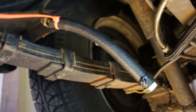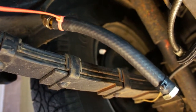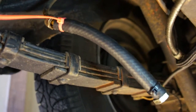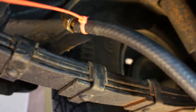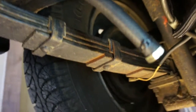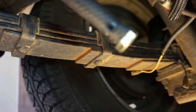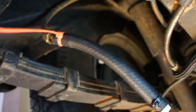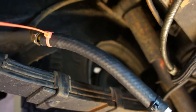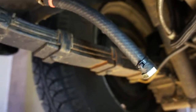It was a pain to stop the fuel from coming out, so I came up with this little attachment. I got a nine-millimeter inside-diameter fuel hose and shoved it on the inlet copper tubing, then threw a bolt that's the right size in the end of it. It's pretty well sealed up, but I lost a good eight ounces of fuel before I got it all stopped up.